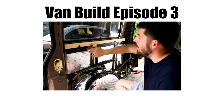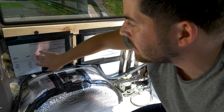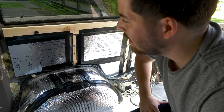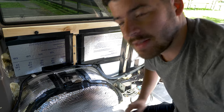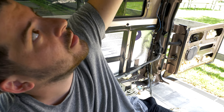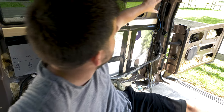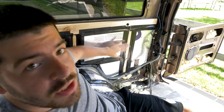This is all going to be covered with vinyl-ish walling. And this right here — I'm gonna forget the name — it's like one-inch thick polystyrene insulation. The roof of my van isn't insulated yet because I still need to get the Maxx Air fan installed. It's like 80 degrees out and the roof is burning to the touch. But the insulated walls are absolutely cool to the touch, and that's the goal for insulation — just keep everything cool on the inside of the van.